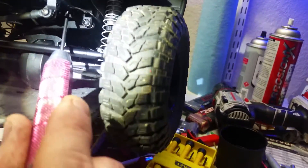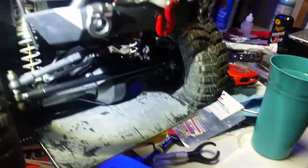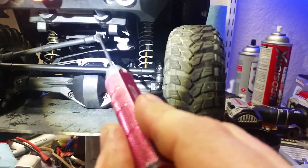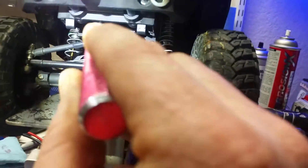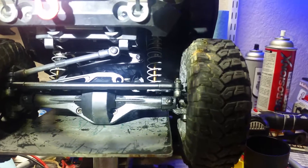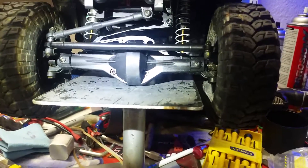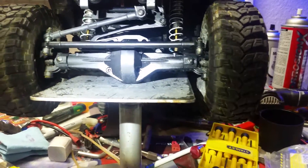Whether you're running a GPM or any brand of panhard bar like this — I think we call them panhard bars down south — it comes with the plate that sandwiches between the frame rails, the triangulated piece, some spacers, a little metal spacer, and all the hardware you need. But it comes with a short arm. Don't use it — get a longer one, make one, or buy one. I'll try to put the measurements in the description below.